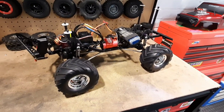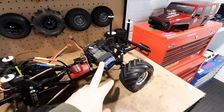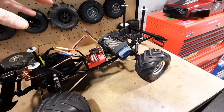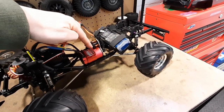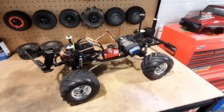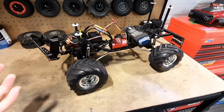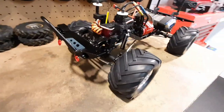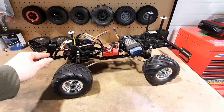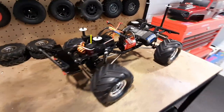Really, that's about it. The only things that take this away from being a crawler and into the league of mud trucks are rotating the battery 90 degrees — totally reversible — and the motor/gearbox assembly, which comes off with just six nuts and bolts. So you could have one gearbox and motor for crawling and swap in the mud truck setup. It's completely modular; you don't have to compromise your crawler forever or waste money on a single-purpose build. Most of this was built from spare parts and a donor car. Hopefully the weight distribution change and suspension tweaking have sorted the wheelies — it's a basic build but it's going to be a riot.